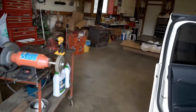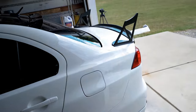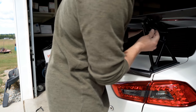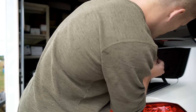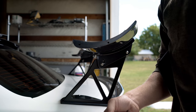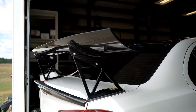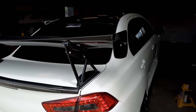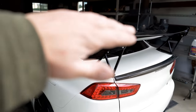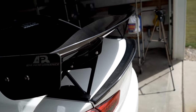Now it is time to get the wing itself on — I'll throw on the end plates after but I want to get the wing on first. So grab the big boy. This is only a 67 inch wing — they make a 74 inch as well, but without this being wide bodied I don't want to go something super wide because then it looks funny. They are adjustable — I always like to have them tilted down a little bit. For now I'm going to throw it in the middle hole. The wing goes on the outside of the mount, not the inside. The hardware they send you is so nice — APR engraved into it. Looking good! With all my new horsepower I really need this big wing. I think I really like how it's positioned right now. There's a little tilt forward but nothing crazy. Look how sturdy this wing is — doesn't move at all.